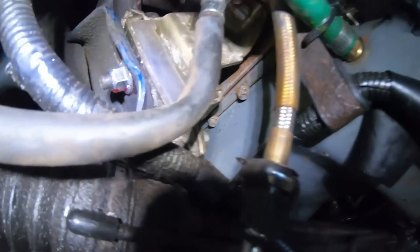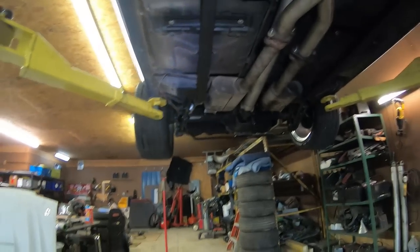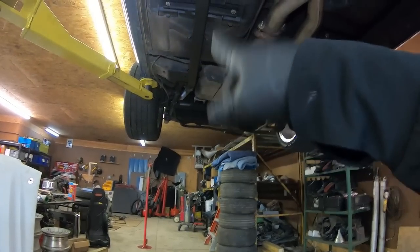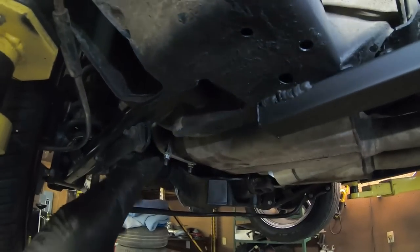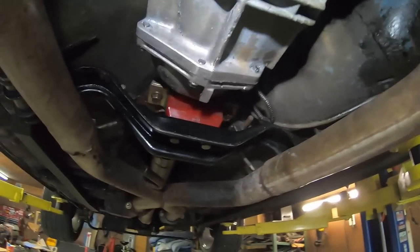Me and cousin Paul are going to show you what we did. We went ahead and replaced it with the poly bushings and put the subframe connectors on, which I think is a huge upgrade for this car. They're nice and thick and strong, and they bolt to my seat. When we put these subframes in they went right in — they were already touching the frames, which tells me the car wasn't tweaked bad at all. They were touching the torque box and were perfectly formed with a little bend in them from the way they're made. Combined with the control arms, the bushings, the subframe connectors, the new motor mounts, and the poly bushings, I'm pretty confident this car's gonna hook hard and be nice and tight.